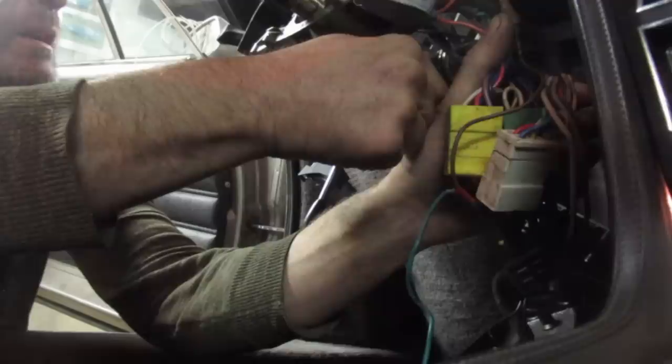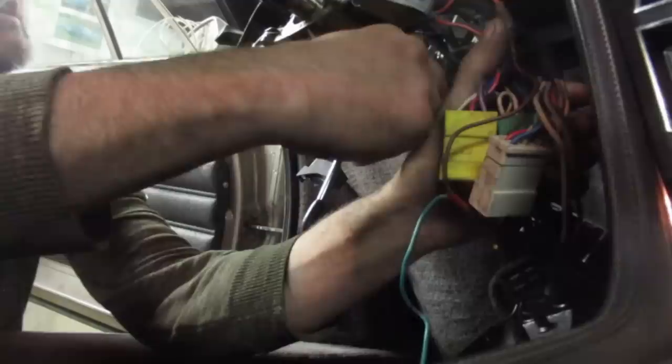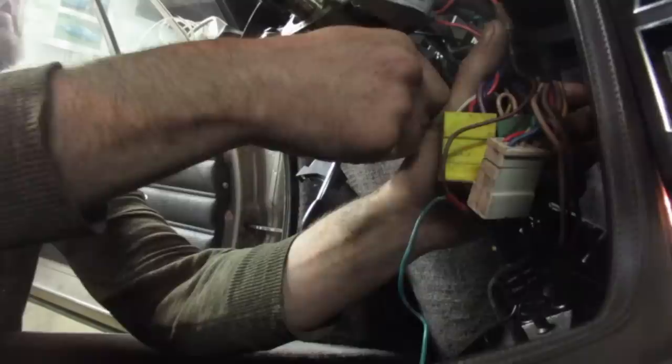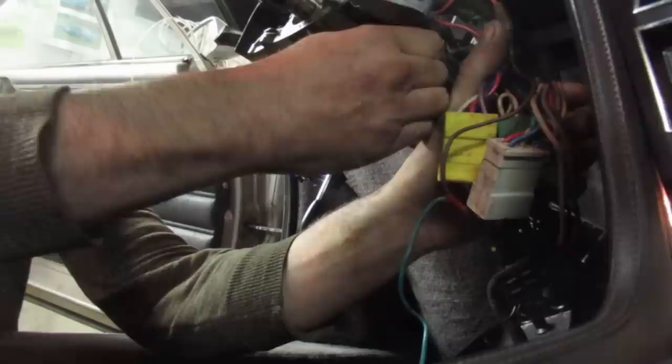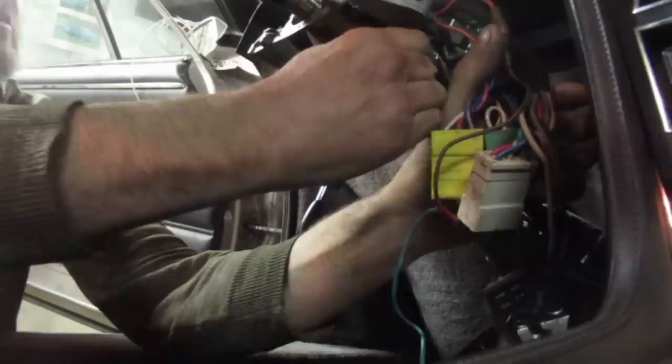Okay, hey Frankers. I'm just going to push this out of the way here and we're on. Ready? On. You got 12 volts — 11. That battery's been running that car all week. We're good. Fantastic. So it's interesting — when you turn the key on it primes up the pump, and then when you turn the key to start it runs the pump again. That's what the second hot wire is. Well, you know the switch works and we've got fuel pressure. It should run.